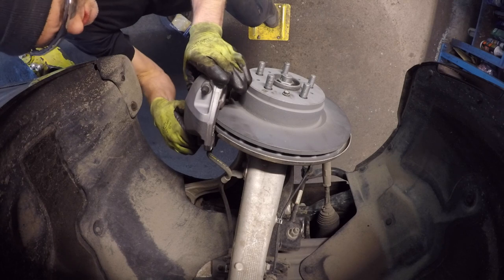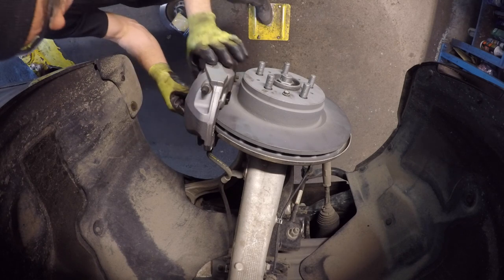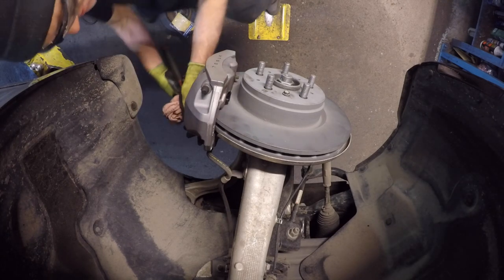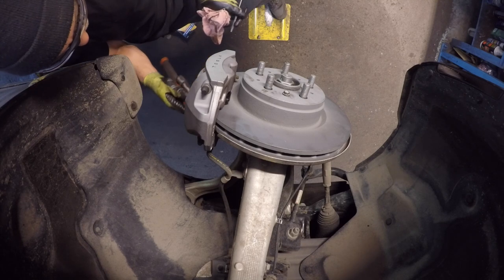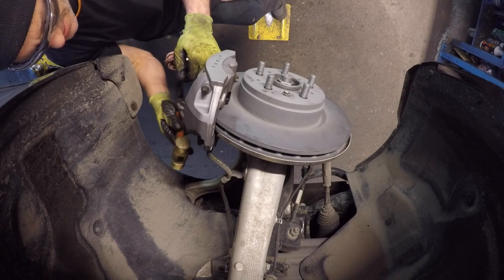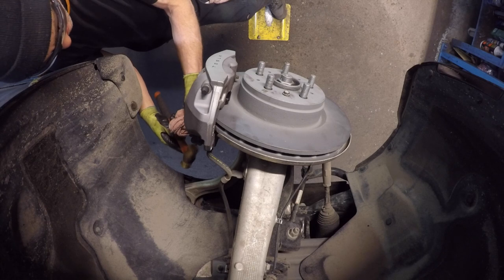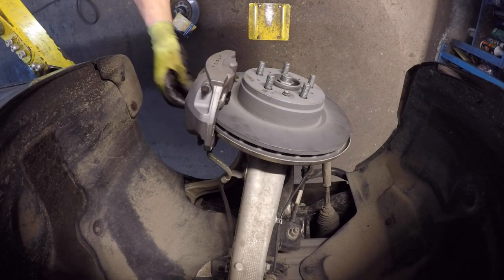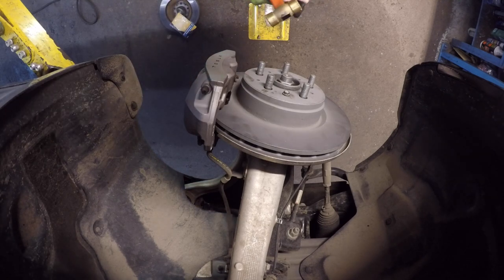See how much easier this stuff is moving for me, even with my bare hands, as opposed to before. I mean, these pins are almost fully inserted. And there's a tension clip, like a C clip, that holds these in place. So they have to be struck back in place just as they had to be struck out. That's it. And that's the brakes on one corner.